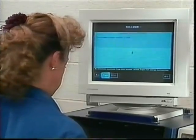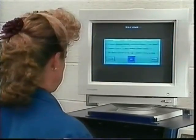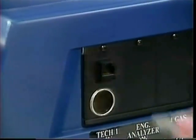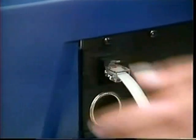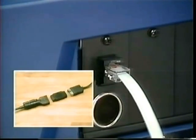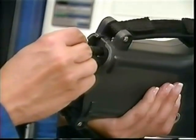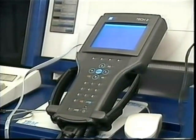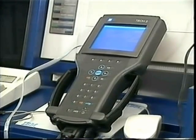Communication uses an RS-232 connection between the Tech 2 and the TechLine terminal. However, the Tech 2's RS-232 connection requires a serial data port adapter on terminals built without one, or on a T-100, you'll need the DLC-to-DLC adapter, just as was necessary with the Tech 1. Also, use the included external power supply when interfacing with any TechLine terminal. Once the Tech 2 identification appears on the tool's screen, follow the terminal instructions to complete the software programming.